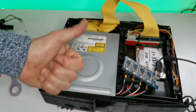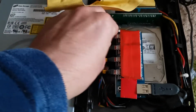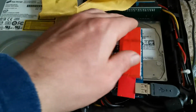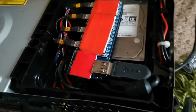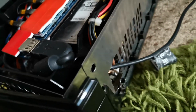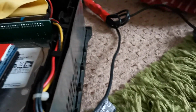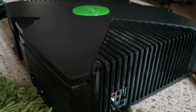You can use a lot of devices with this, including the Retro Bit adapter that gives you the option to set up a PlayStation 4 controller, but I'm sticking with the 360 pad as it's the obvious and most convenient choice. Just to be on the safe side, I kept the padding on the board and wrapped it up with insulation tape. Poundland saves the day again. This helps if any electrical and metal touch together. It could cause a short out and cause some big problems.